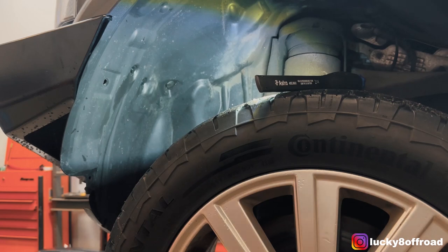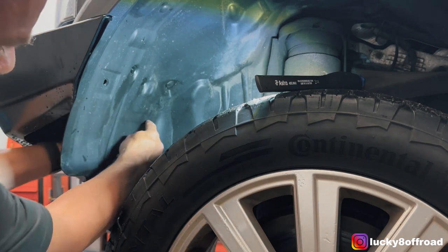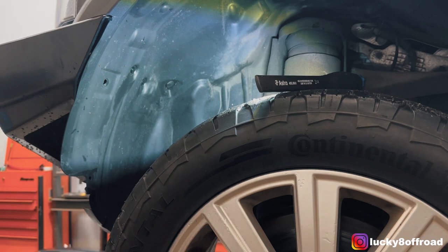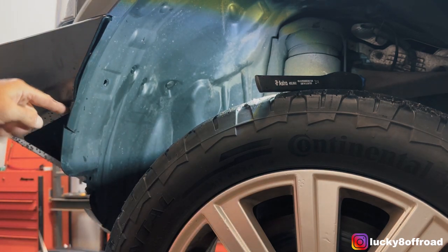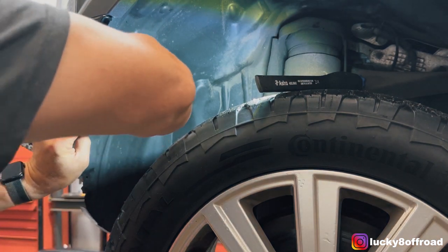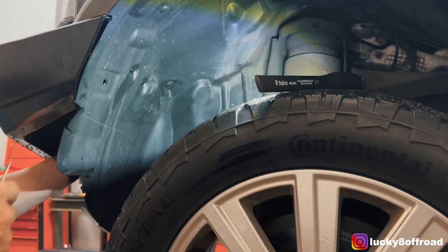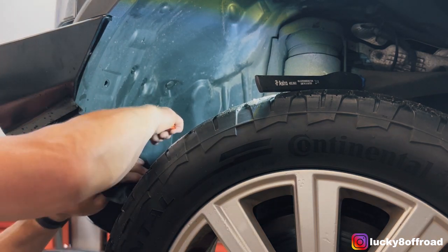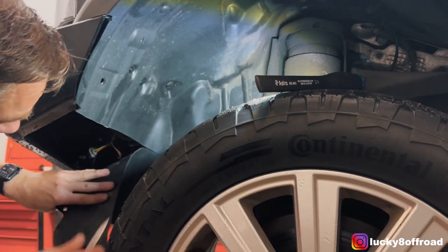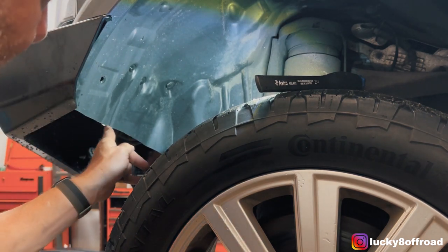Time to cut the inner fender liner. I just use a razor knife — cut it right across like this, come over to the end and drop it down. You can always start lower and work your way up to where you need it to be. I use this ridge on the bumper as my starting point. Shouldn't have to say this, but be mindful of what you're cutting on the other side — there's electronics and all kinds of goodies, so watch out for that. Then I'll just get the Dremel or the whizzy wheel to clean it up a little bit.